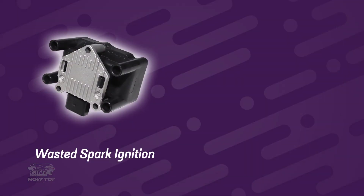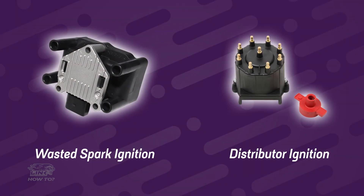The engine we're using has one ignition coil per cylinder, which is why it wouldn't start when the trigger offset was incorrect. If it had a wasted spark ignition system or a distributor ignition system, then it actually would have started with the incorrect trigger offset, but the sequential injection timing would have been incorrect. So, if you have an engine with one ignition coil per cylinder and everything looks right but it just won't start, don't forget that the trigger offset might be the problem.